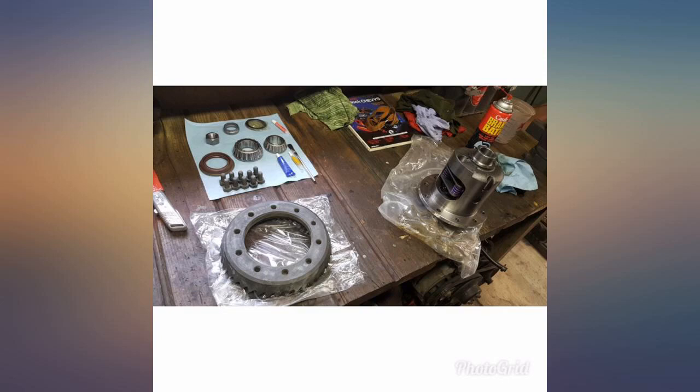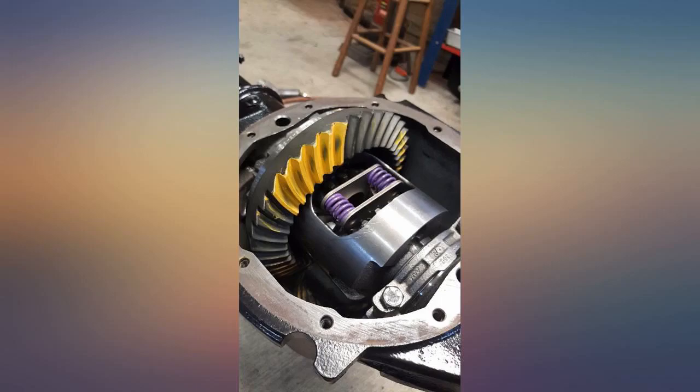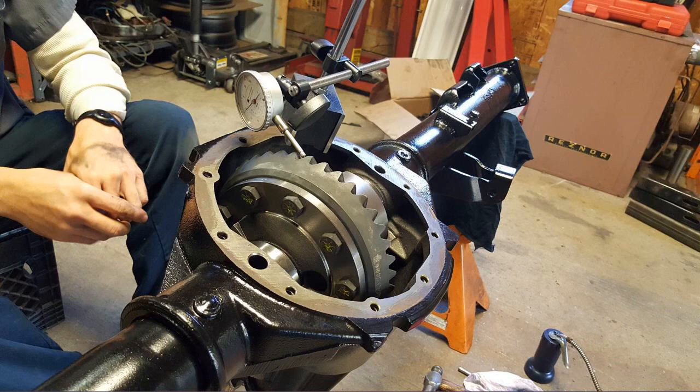This set is for the first 2 types. If you have a Yukon built before June of 1999, it likely has a 1998 rear end, which is only 8.5 inches. This set will not fit in that rear end — the bearings are too large — despite what Amazon says.